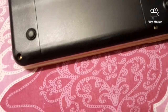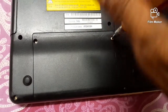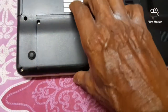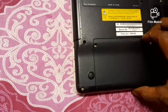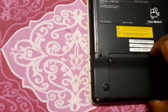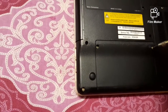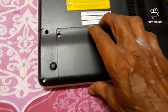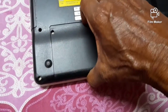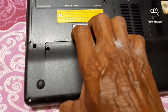In the case of some makes like HP — most HP laptops — the access is made from the keyboard side. First, the keyboard is to be lifted or removed after removing three to five screws from the back panel. The keyboard is removed from the top, and then you can access any internal parts.